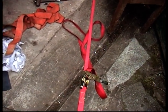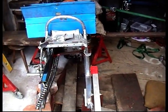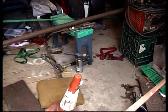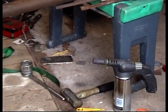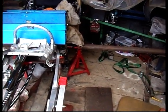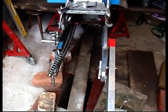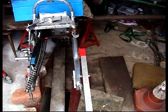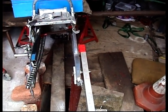I've tried brute force but that wasn't strong enough — I could hold it but it sprung back. I tried it cold but it wouldn't budge. So I've tried it with some warmth from an ordinary hand-held blow lamp with a butane canister, and not an acetylene welding torch as that would be too hot and soften the metal too much. I've just wound it slightly to make it easier to pull, hopefully. Once I've done that one, I've got to pull the other one over, so that the gap between the two is as it was before — just a fraction over ten inches, ten and one thirty-second to be precise.